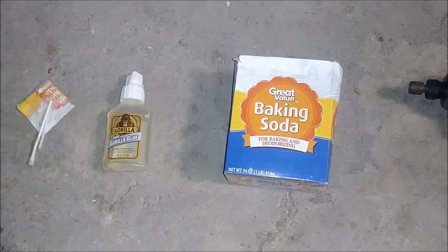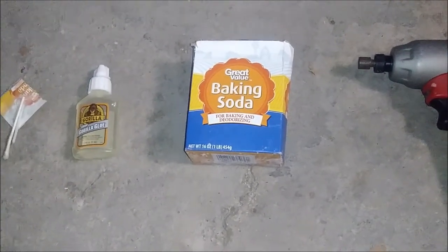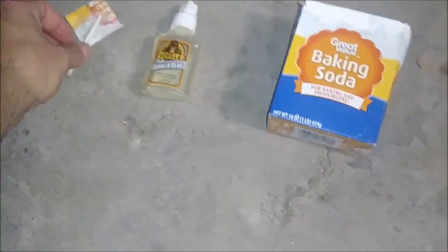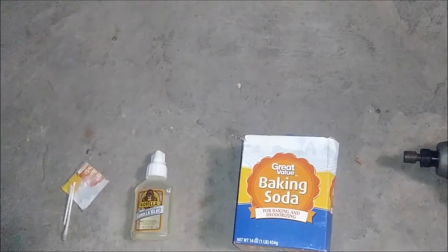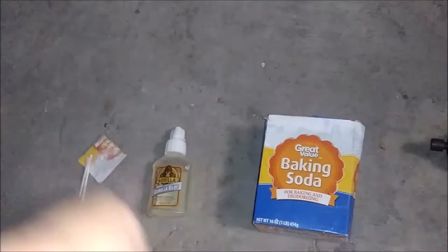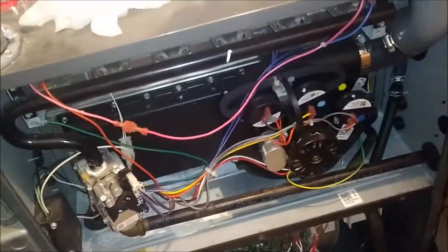Let it sit for 24 hours and that'll do the trick — it got me by for four months. If you don't want to replace the pan right away, this simple fix can save you a lot of money. For a small hairline crack or puncture, you can also rip the end off a Q-tip, soak it in the baking soda and super glue mixture, wad it into a ball, stuff it into the crack, then add more mixture on top. It'll dry to a nice hard lump and patch the hole.